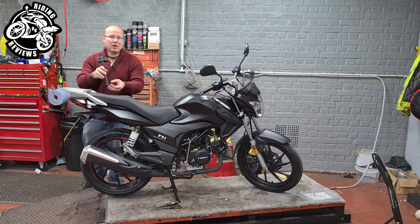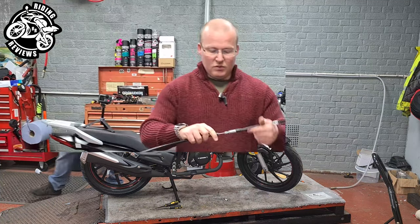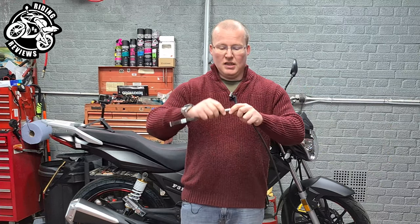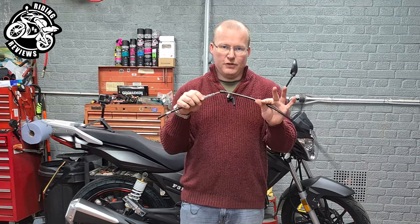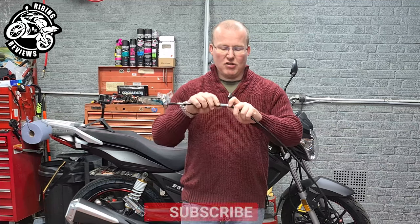The second adjustment I won't actually show you on the bike but I do have a demonstration cable here. This is pretty much the same thing again — this is a clutch cable. Again you have an adjuster and all this does is extend the outer sheath of the cable, because it's the inner part that will actually stretch.